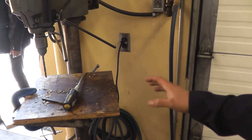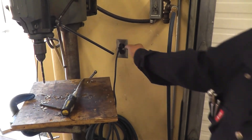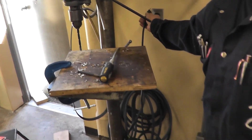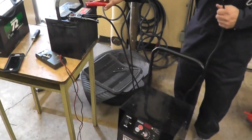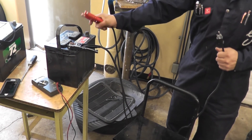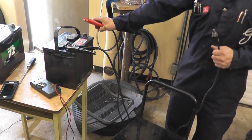When you disconnect the charger, it's very important that you always unplug it from the wall first. Unplug from the wall because you don't want any spark. If you don't unplug from the wall and the charger is still on and you take the alligator clips off, it's going to spark. Hydrogen, spark, kaboom. So please don't do that.